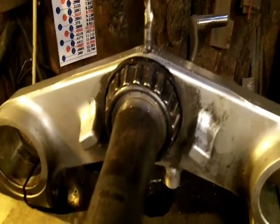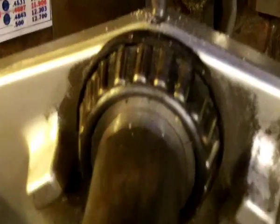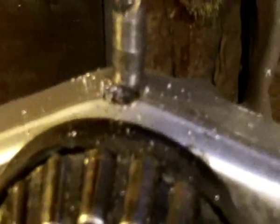Right, I just wanted to show you this while I was drilling this out to virtually the final size. I could hear it squealing a wee bit. I've had to sharpen the drills probably 10 times, about 5 for the size below this, about 3 times, and 2 for the first size I started drilling out, which I think was about 3.5, 4 millimeters. But as you can see, it's just about to fall here. It's actually brought the pin right out. Oh, sorry, there you go. It's actually drawn that out as it started to heat up.